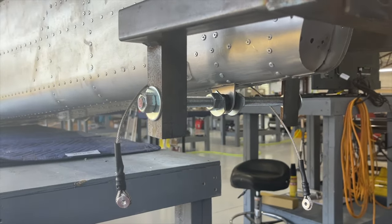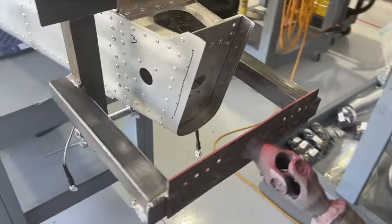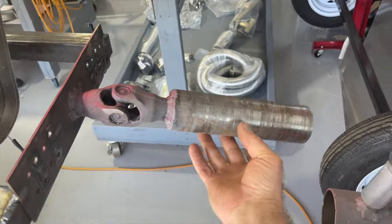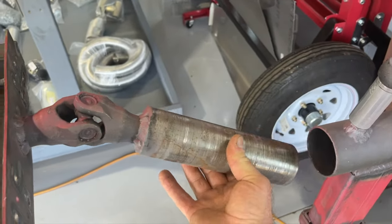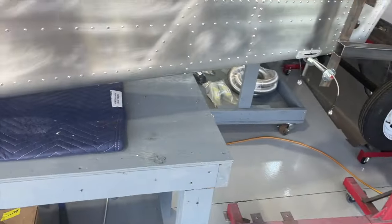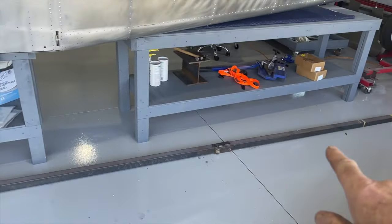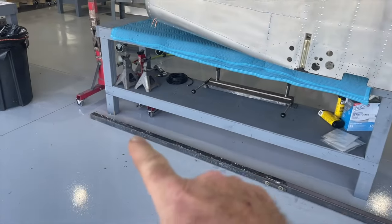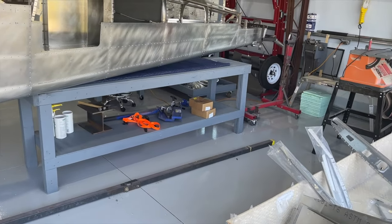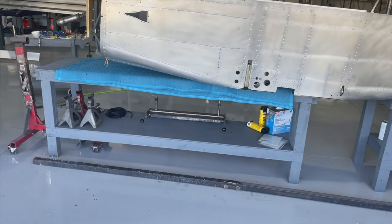It's pretty well supported on the top and the bottom. And then we have a fork that comes off of here onto a plate that also connects to a U-joint. Another tube going into this receiver here and the other modified engine mount. The critical piece to all of this is really this spine that connects the two. That way, you don't get any movement and nothing is distorted. Once these are on the stands, the spines will go in and lock it all together and we'll have the Sling on the rotisserie.